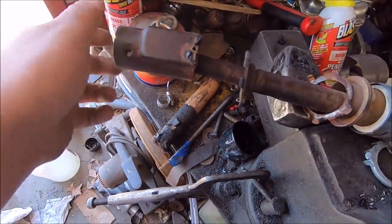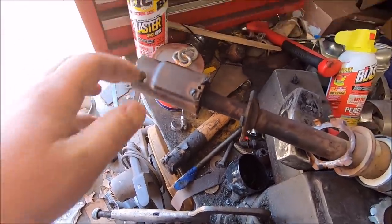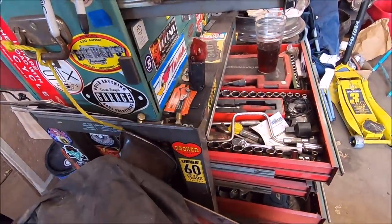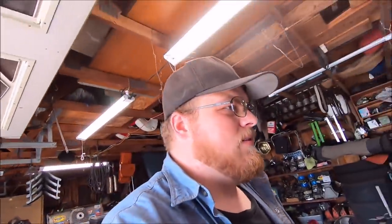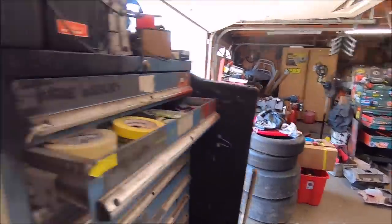So we dug this guy out, took the coupler off, which is all original hardware, and this thing is still tight. I removed a bunch of the grease out of there. I'm going to say it, this reproduction rebuild kit, don't bother with it. Fine and original, they fit so much better. The pin is actually still stuck in that steering column, whereas my other one just fell right out, my reproduction stuff. So don't replace that stuff.